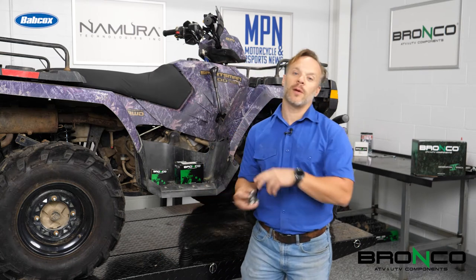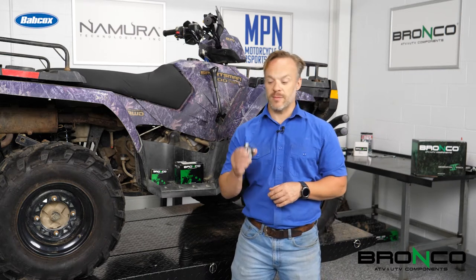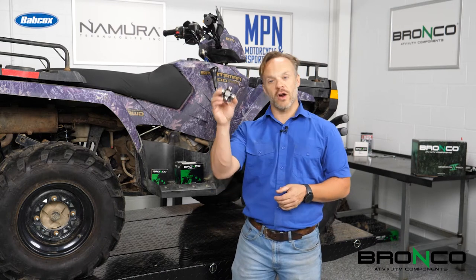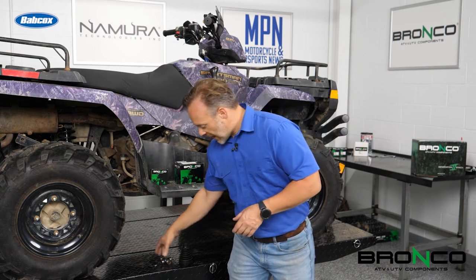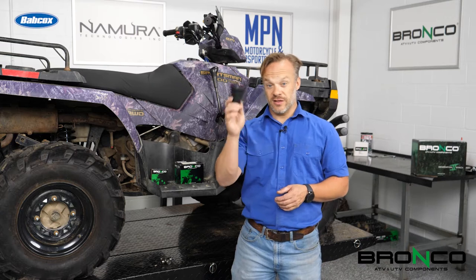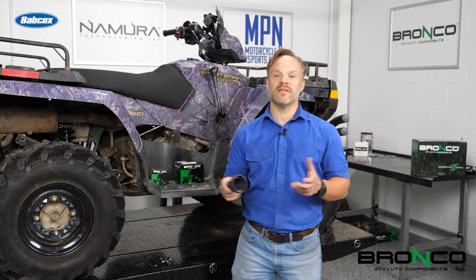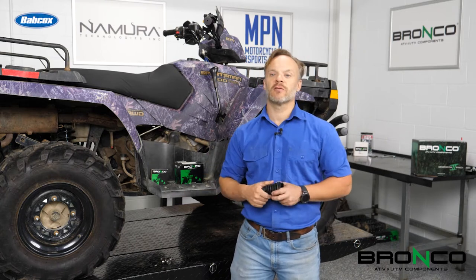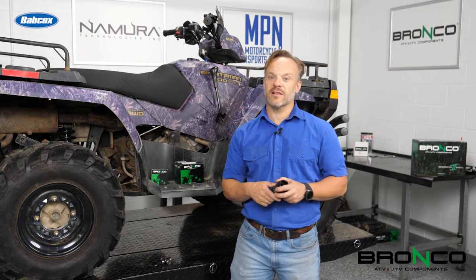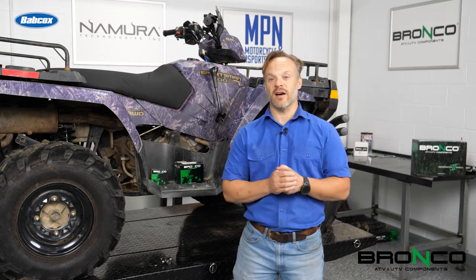We're going to do a couple of the U-joints — some of these are loose, so it's time to replace them. These are what allow a shaft of any sort to go around a corner. On top of that, CV boots: these are what keep the grease in and the muck, dirt, and grime out of those CV joints. Those axles are expensive to replace, so if you've got even a small tear in a boot, it's time to pull that axle apart, replace the boot, freshen it up with new grease, and you'll probably get some more life out of it yet.